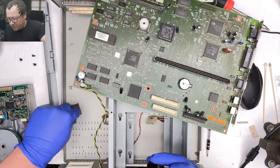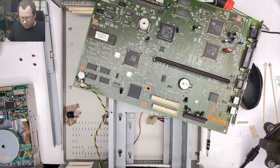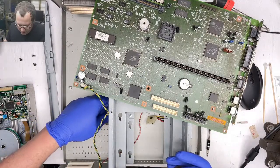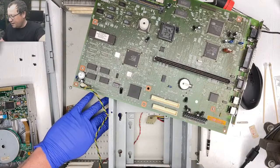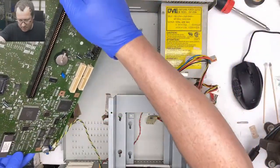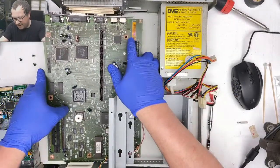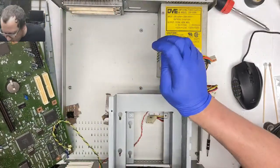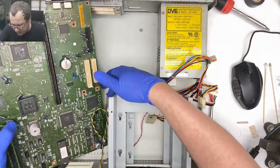So this might actually be kind of interesting, because if this were really a 386 SX16, it's kind of a boring little processor. It's semi-castrated, right? It's gotten half of its RAM bandwidth restricted, and it's relatively slow. The 386 SXs came out, I think it was 3 years after the regular 386 came out, and then they had renamed the 386 the 386DX.